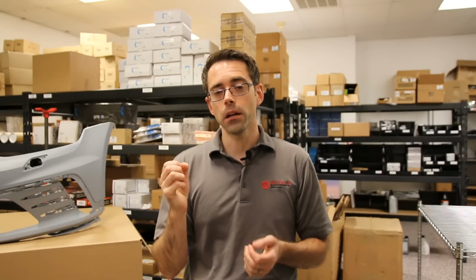The issue you're having is hard for me to answer specifically, but here's what anybody would do when diagnosing an issue like that. The number one thing you're always going to do is take the power module out of the car, remove it from the vehicle, and try to duplicate the same circumstances that you're currently experiencing, and do it as many times as you possibly can to try to recreate it. If it doesn't come back, it's a pretty safe bet that something related to that is causing your issue.